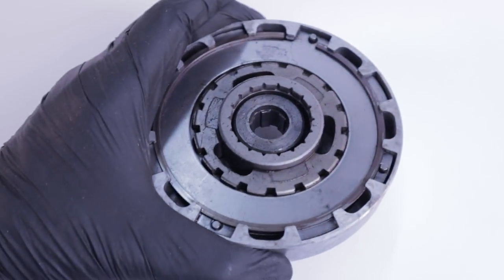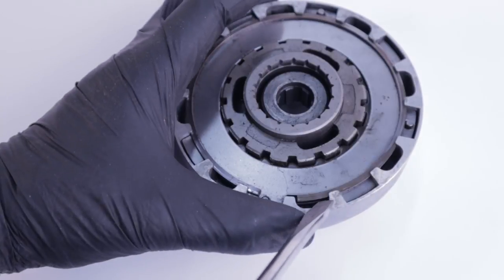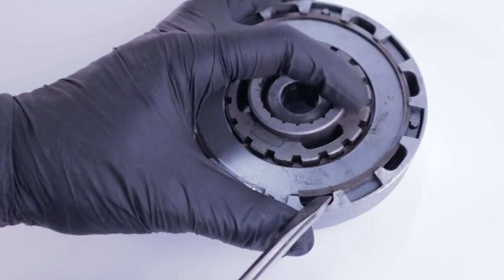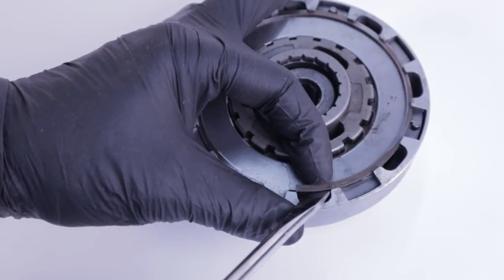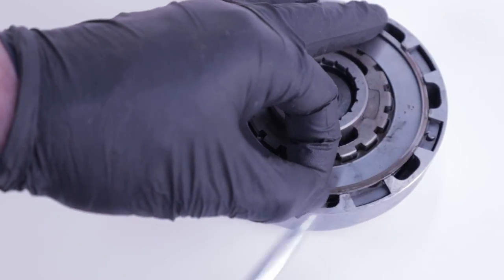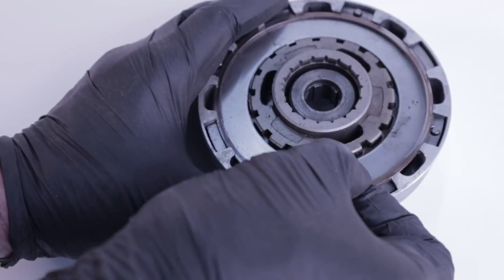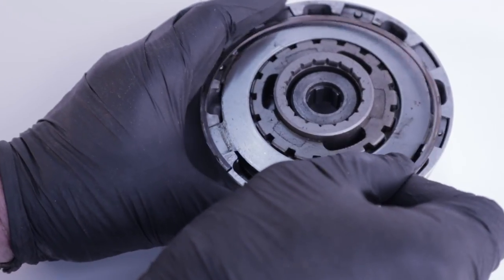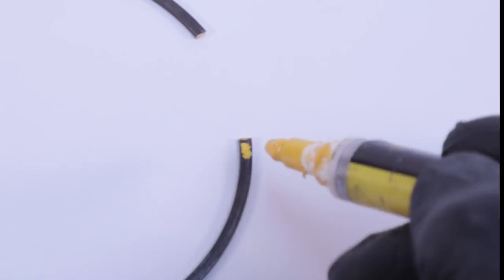So this is the ubiquitous Honda semi-automatic clutch. Start by removing the set ring. To remove it, wedge a broad tip flathead screwdriver into the openings around the perimeter and gently work the ring out of the groove in the clutch outer cover. After you pry it out of a few grooves, you can basically pull it out by hand fairly easily. The set ring is directional, so mark the top face for reference for reassembly.